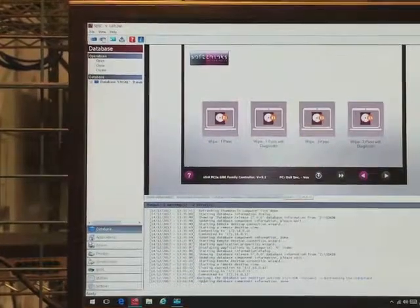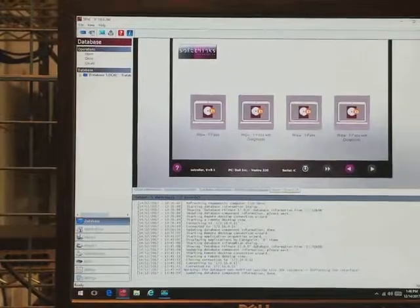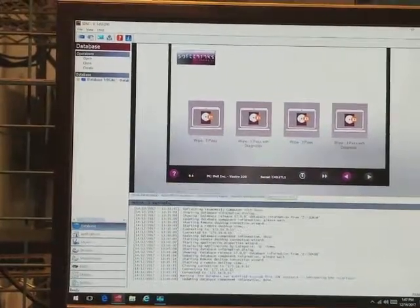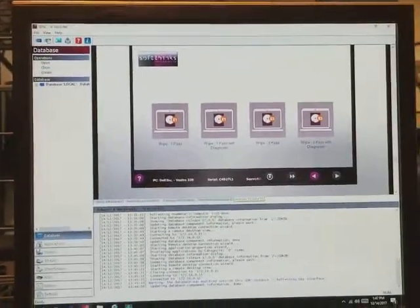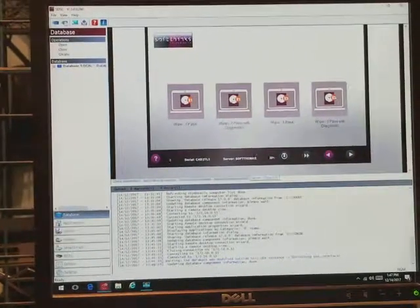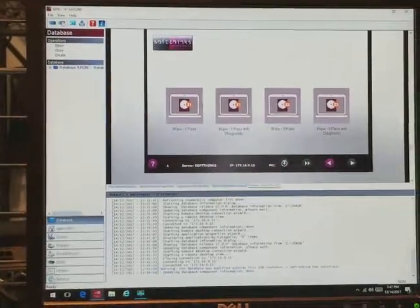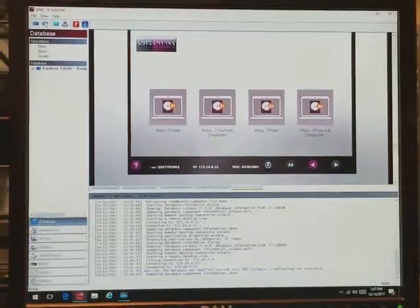But basically, you will press that, and for wipe 1, we're looking at anywhere between 20 to 30 minutes, and wipe 3 could be upwards of 4 hours, depending on the size of the hard drive. And that basically concludes data sanitization and diagnostic through our console computer here.